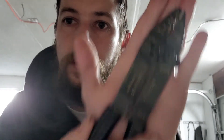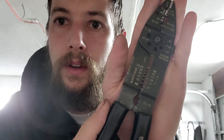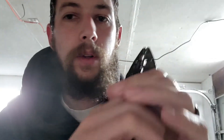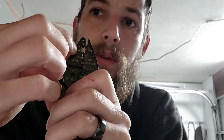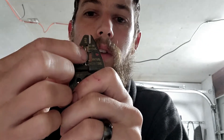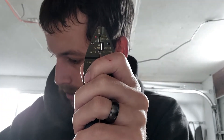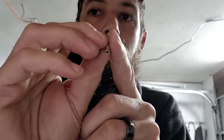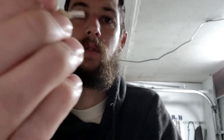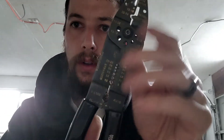These are the wire strippers I typically use — just Matco. I've been using these for years and never had a problem stripping wires; they cut perfectly fine. Then you've got your insulated crimps, non-insulated crimps, and cutter. The red and blue insulated sections crimp the red and blue connectors respectively; the yellow section is for larger yellow connectors. The non-insulated section is for non-insulated style connectors. These work really well — I recommend this style.